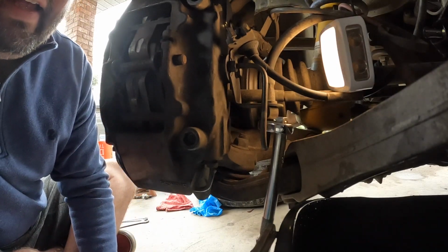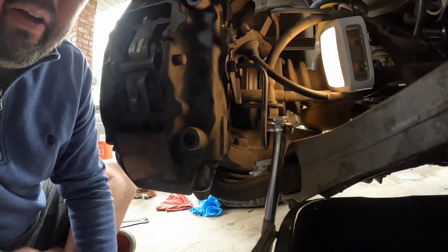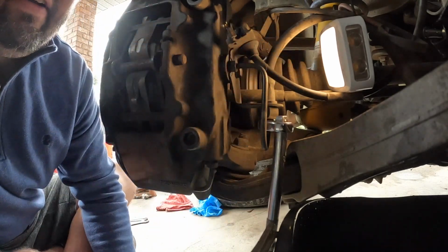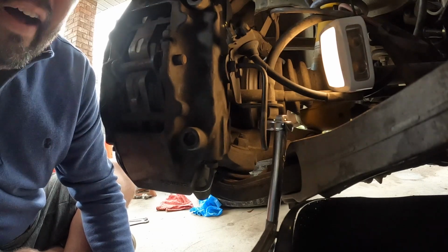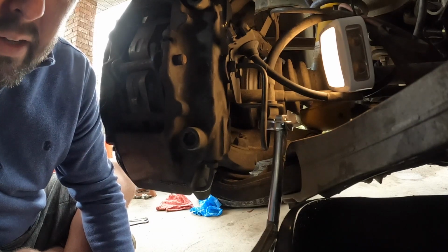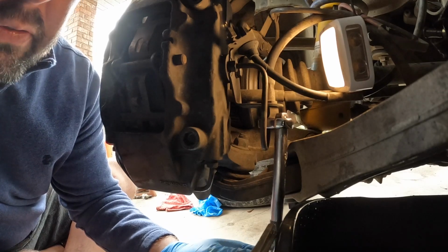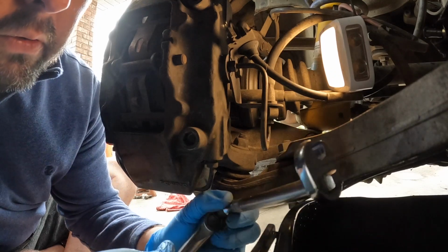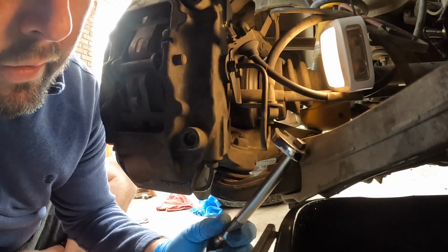Okay, so adding to my anxiety here, I am left at home with the only car being up on jack stands and the brakes already dripping out of this side right here. And it turns out that I needed a 10 millimeter flare wrench to get on the bottom of this. I did not have a 10 millimeter flare wrench. I had a regular 10 millimeter wrench and I wasn't about to try to round that off. So I have a crow's foot and it happens to fit in here nicely and it has those extra sides to grip onto. Here, I'll pull it off and show it to you. Look at that. That should do the trick.